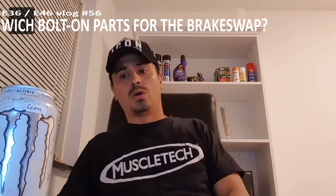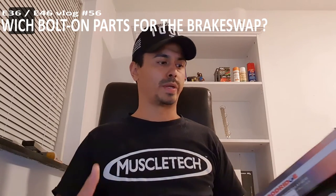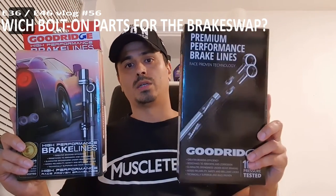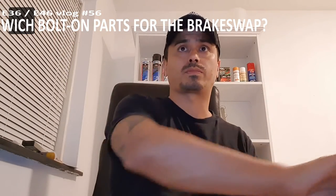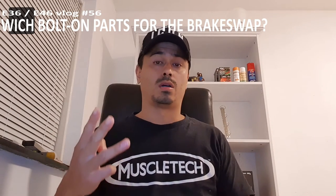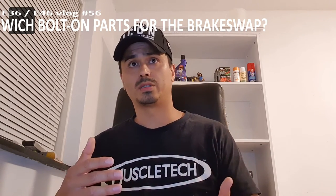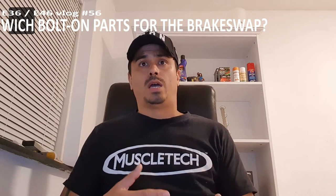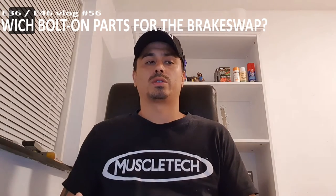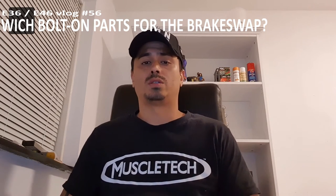I need some showcases and then we're good to go. It's essential to know what parts to use for the 330i big brake swap. For example, are we going to use the brake lines for the E36 or the brake lines from the E46? Which ABS sensors are we going to use? What brake wear indicators, bolts, axles, wheel hubs, which brake cylinders? And do we have to exchange the ABS computer? I already did some research and got some answers. I need to do some more research and check some things myself, so I'll come back on that tomorrow.